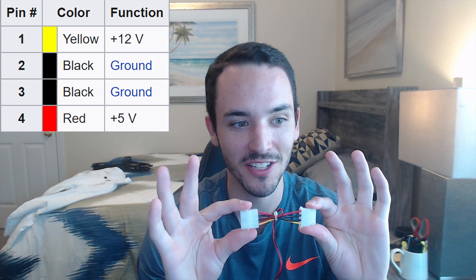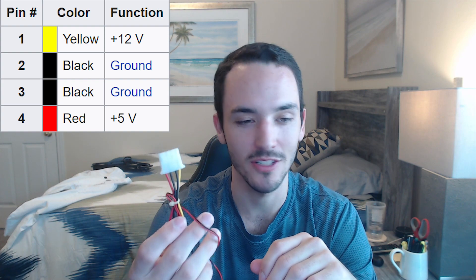That's pretty much it — very simple. Maximum power is 12 volts, four pins, pretty standard. You'll see this in about every computer. It was a huge standard for a long time until SATA came out, I think in 2003. And Molex itself goes back to around the 1980s.